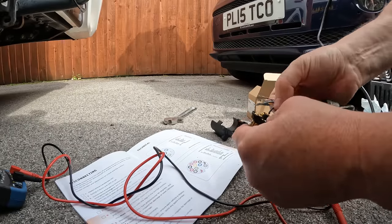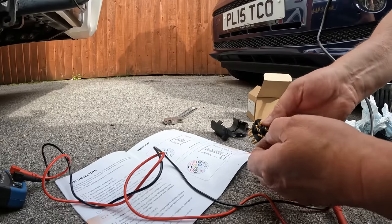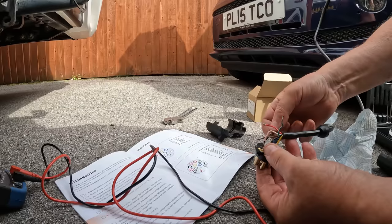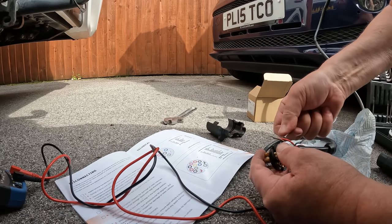It's a case of putting the wires back on the plug and following the diagram — it's quite easy. It tells you which colors go to which pins, and all the pins are numbered so you can see where to put them. Obviously don't do this without a diagram, or you could be in serious trouble. It took a little while but eventually I got all the leads in. I used a small watchmaker-type screwdriver so as not to over-tighten, then came back with a slightly bigger screwdriver just to make sure they were tight — but don't over-tighten, you can break the wires.